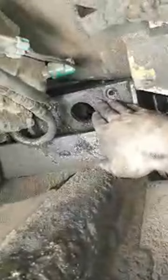One of the biggest issues we're running into with the way this is designed is the starter housing on the bell housing is really right in the way. So, you guys seen how easy that one came out. This one can't even come out. We can't even get this motor mount out of here because we got a PTO pump in the way and the starter is in the way. Right? So what we're working with is this is still down here, right?